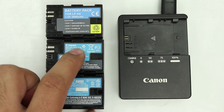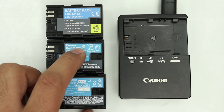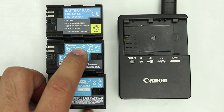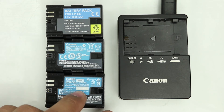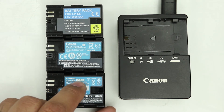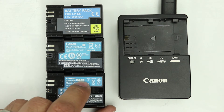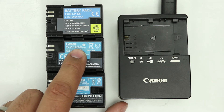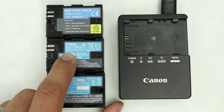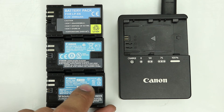Also, you'll see on the LP-E6 it's got the word 'LP-E6' right next to the word 'battery pack', so this is the E6 model. The E6N has right underneath the Canon logo 'model LP-E6N'. The differences between these two batteries is one's got 1800 milliamps with 13 watt power, and the E6N has 65 milliamps more — it's got 1865 milliamps with 14 watt-hours.